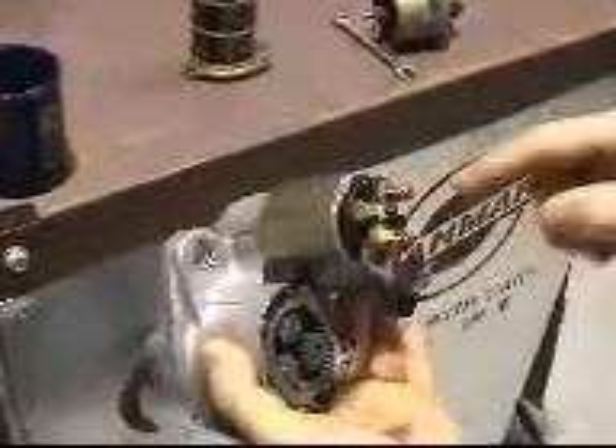You can get a product from CRC or Worth — it's a battery terminal protector, a spray-on product. When you hit the key, you apply power there which energizes the solenoid.